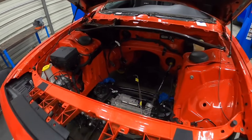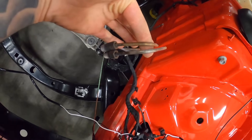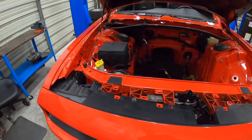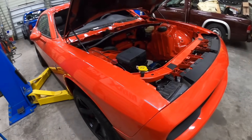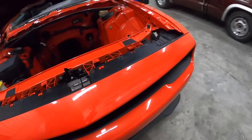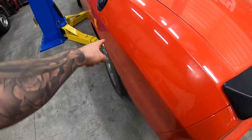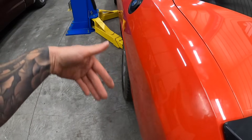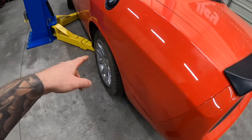There are some things I've got to sort out first. One is the brake lines — you can still see remnants of the fire on them — so I want to replace those, and also the fuel line. I also need to fix the wheel alignment. When this car had its incident, it looks like it spun around and hit a curb, because one of the original five-spoke Hellcat wheels was completely taco'd. We removed it and have a 300C wheel on there. Even though the knuckle was completely busted and we replaced it, the wheel is completely toed in and there are some bent pieces.